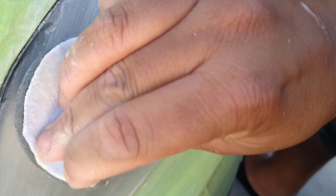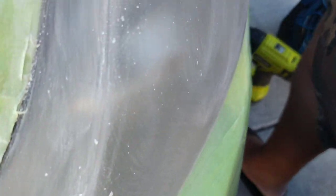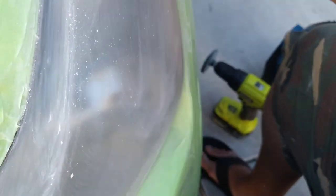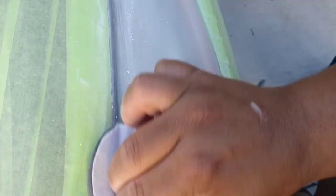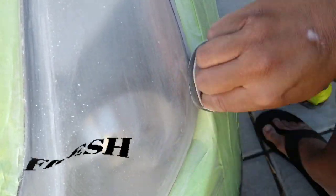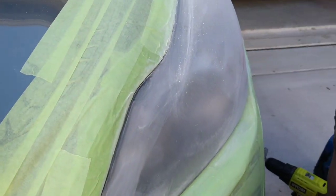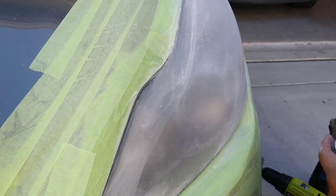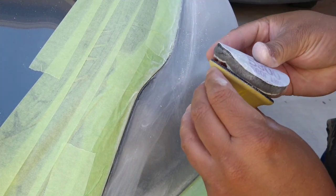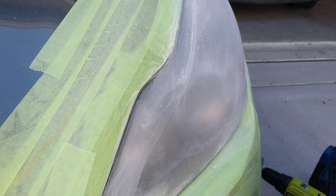I'm starting out with the P800 on the interface pad because it's fresh, on these hard-to-reach spots. You always want to start with the fresh pad on the difficult areas. Why? Because you have to do less work when it's fresh — you don't have to grind on those hard parts as long. You just hit it real quick because it's a fresh disc or pad. If you were to do this at the end of sanding everything else, it would be damn near dead and you'd be beating a dead horse in those corners and hard-to-reach spots. It works out to do it first because it's fresh.